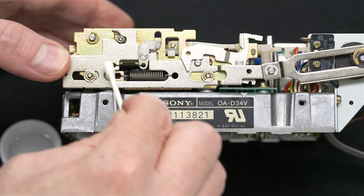And there you have it, folks. That's all there is to it. I realize that this video doesn't cover every possible problem that could go wrong with these early 400K 1984 floppy drives, but by far what you've seen in this video is what plagues the vast majority of them. It really is as simple as frozen up grease that you just have to remove with a little bit of alcohol. And I would suggest you put on a little bit of silicone grease to keep the parts from rubbing too hard against each other and wearing down over time. And I hope this gets you up and running. So thank you for watching.